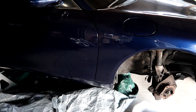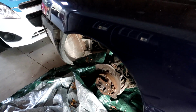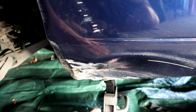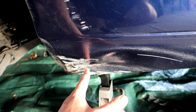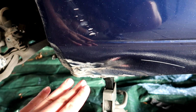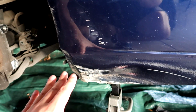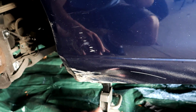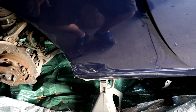After we're done with all the brake area repair in all 4 corners, we'll be able to move over to our body work. The majority of it on the car is sitting right here. Not too bad. I bought a stud welder for this, so we're gonna pull it out with a slide hammer, shape it really nice, put a little bit of fill, and then we should be able to just blend this in, not use a ton of paint on it. I've got a brand new paint system that I can't wait to try out as well.